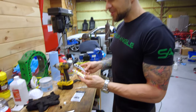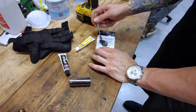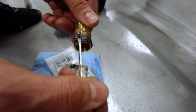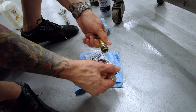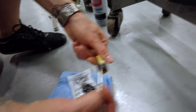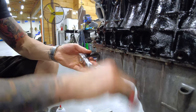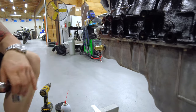It's not a party until you bust out the JB weld. So we're going to make a little mixture here. I'm just going to give a generous coat, just getting the threads — it'll be fine. It's a pretty tight fit. I didn't bury the tap all the way in there intentionally, because I want a super snug fit. That, in conjunction with the JB weld, it's not going to leak. You can see we're not even close to buried — this is how tight it is.